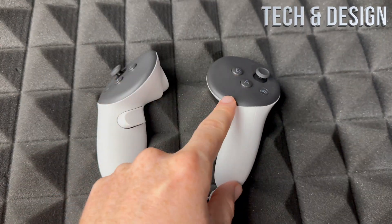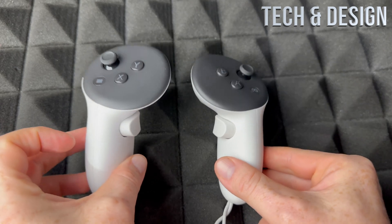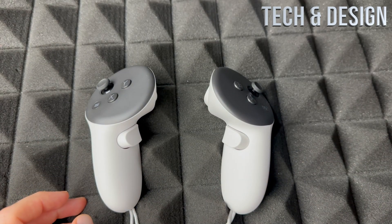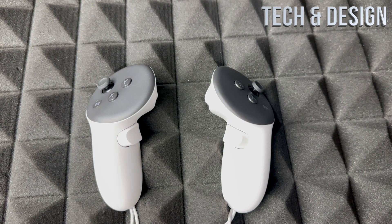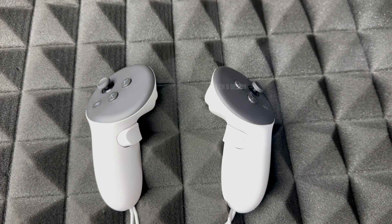Once you're wearing it, don't worry about the controllers — they won't work. Use your volume up or down button to navigate and select 'Factory Reset.' For most of you it'll be the minus button. It's the third option. Once selected, press your power button once — and make sure you're wearing your headset while doing this.